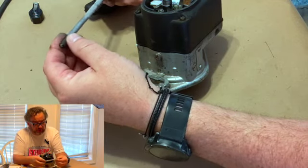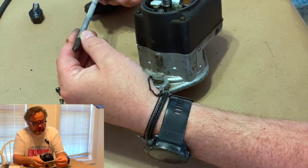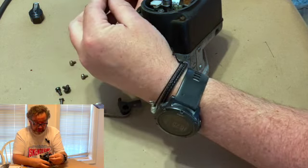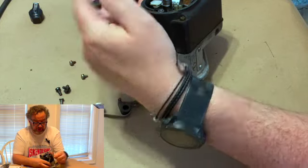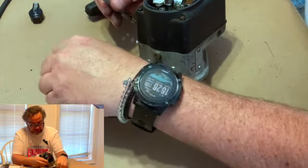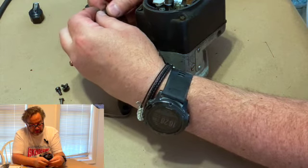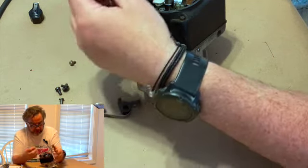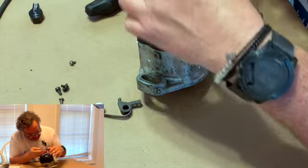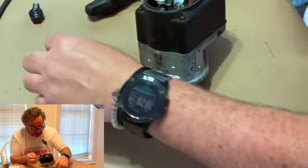This is a KD part number 2282, or 2262, one or the other, I can't see it. But what it does, this little end has a set of ears, and then there's one that's crossways, and it's spring-loaded. So when you turn this, it lines all of them up. You take the screw that you want to load, put it in the slot, turn it, and it holds it. And all it's for is to get your screws started in the holes that you can't reach with your finger.